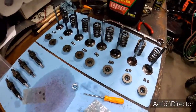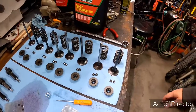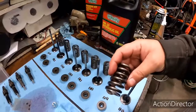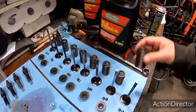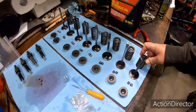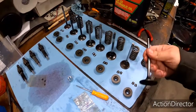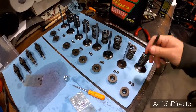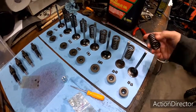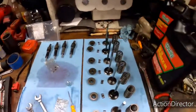Now we're going to go on and finish wrapping up the cylinder head — we're almost done porting it. Then we're going to wash the whole thing, paint it, and load it up with all this nice new hardware. We've got 60-pound valve springs here, and with our new governor spring set at 3,200 RPM we should be able to take full advantage of that without worrying about floating any valves. These valves are going to stay nice and strongly seated in the head.